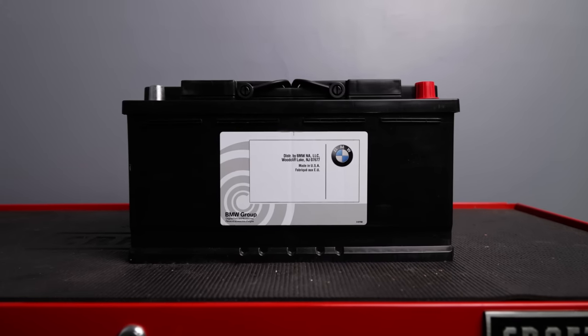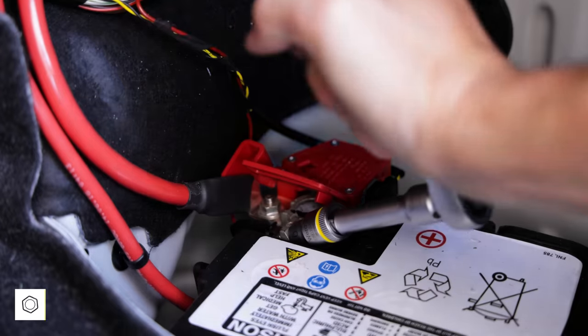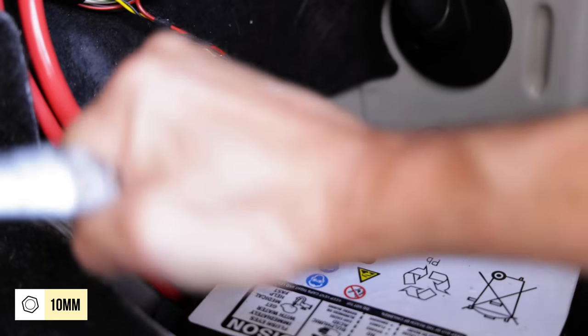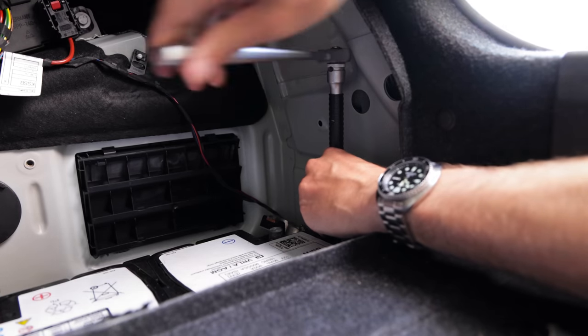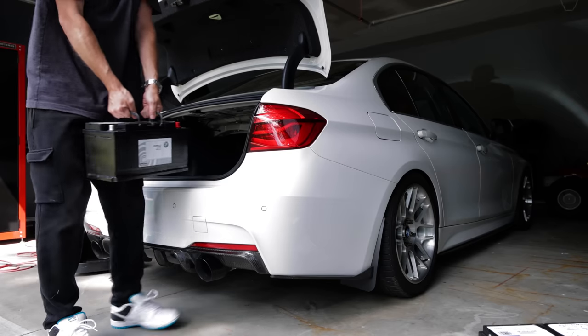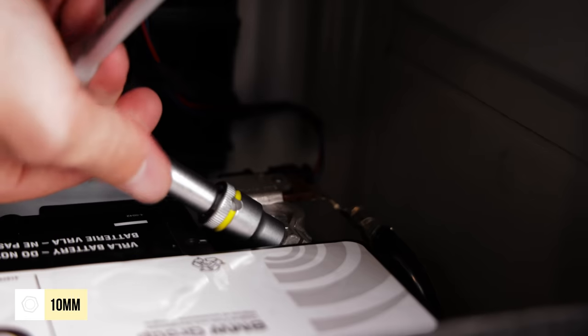Let's talk quickly about batteries — this is the time of year that people tend to have battery issues. I just changed mine a year ago, and interestingly, as the weather's gotten colder that battery DIY video has seen a big spike in views. If you suspect your battery is on its way out — maybe your car is struggling to start, or you've got a battery that's more than five years old — get it tested now. Any auto parts store will test your battery and alternator for free. Don't let your car leave you stranded in the middle of winter when it's zero degrees out.